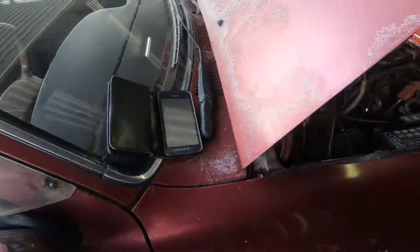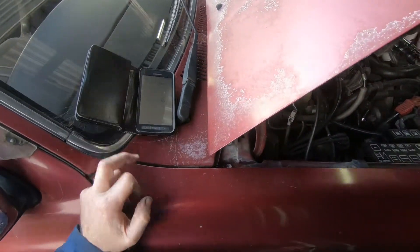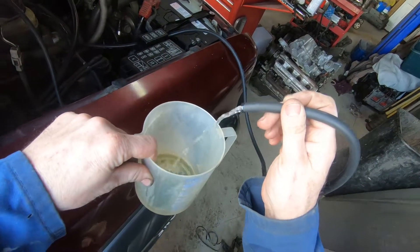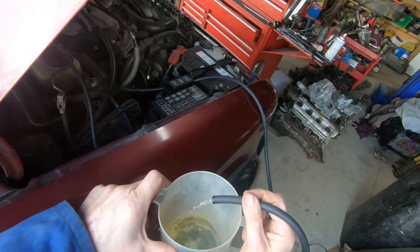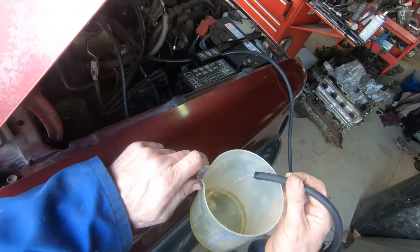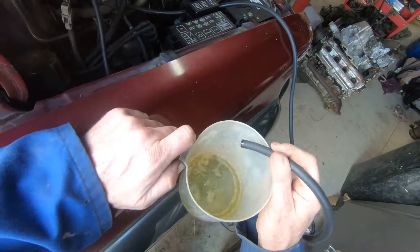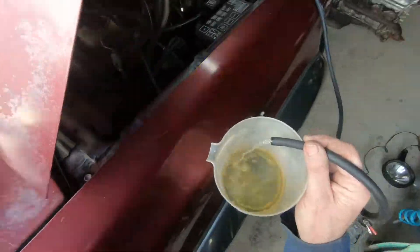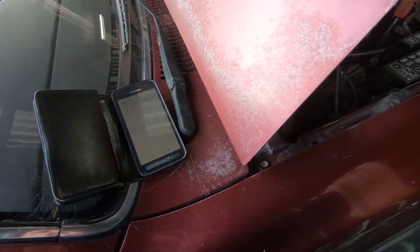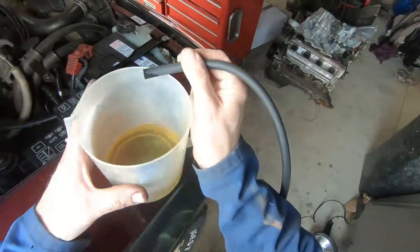I put the line into the container, start the vehicle, and start the timer. Straight away we can see it is quite a pathetic dribble. We're going to run this for 30 seconds. At this point most of the fuel is coming out the return line — the injectors are going for about three milliseconds, roughly one to one-and-a-half percent duty cycle. Watching that timer, watching that dribble of fuel — and that was about 30 seconds.